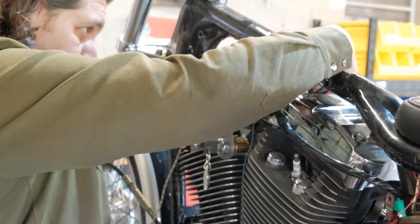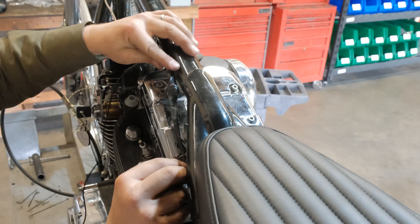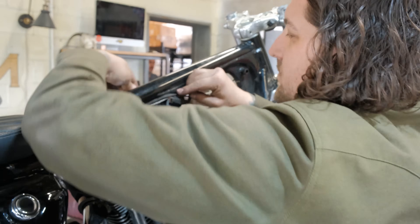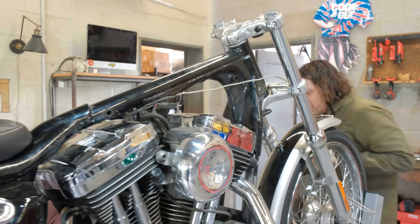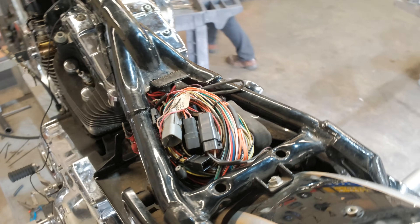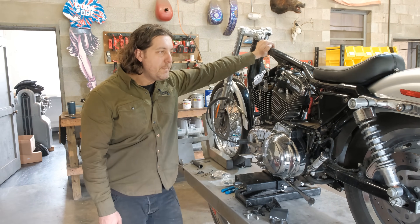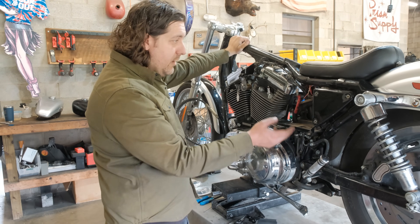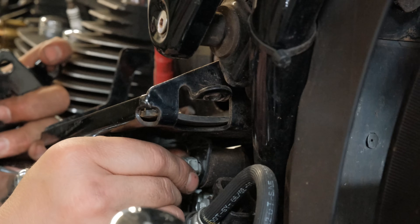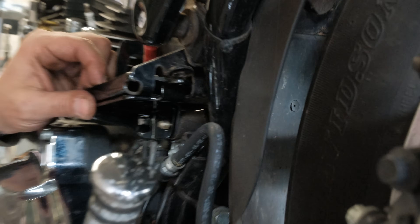We'll mount the bars and the headlight. This part is kind of just playing with the wire, seeing where the routing looks the best and where things are going to hold themselves up without a whole bunch of zip ties — because it's always cool if you use fewer zip ties. Now that we've got all our electronics buttoned up where we want them, we're going to put the coil relocation bracket on and run the wires. The first step is to remove the battery — already done — and remove the lower rubber mount under the battery box. That's where the coil mount will go.